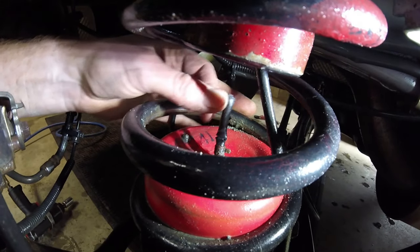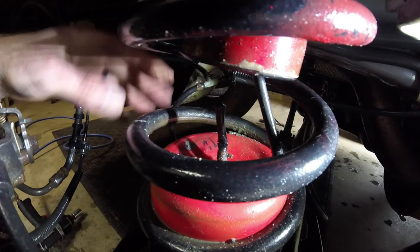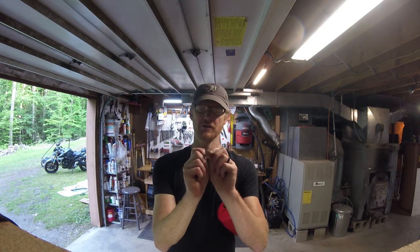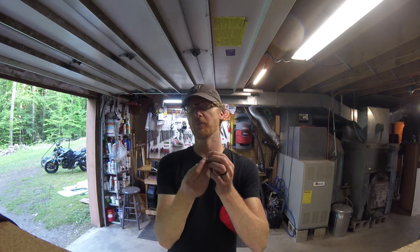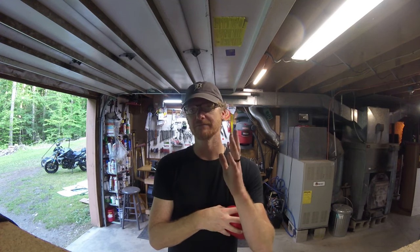So when I saw all these hoses were broke and they were crimped and I could see how they failed, the up and down movement of the van caused the hoses to flex. And just like even a piece of metal, if you flex it back and forth long enough, it just breaks. Well, that's what this hose did. It has clear crimps where it just fell apart at the crimp mark. And it split. Once it did that, all the air came out.